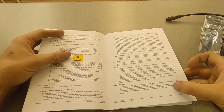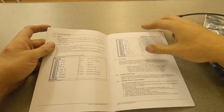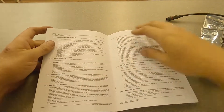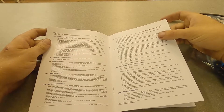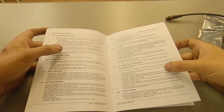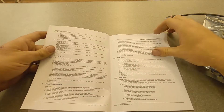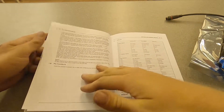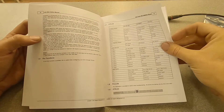The manual talks about using a fast response air temperature sensor, which is what we're going to do. You can see some pinouts here for the internal connectors. It goes through the process of connecting to the ECU, calibrating your throttle, how to make the multi-functional display work in an R34, trigger calibration, and how to set up your CAS sensor. It goes through all the processes you need, and then here's the final output wiring.